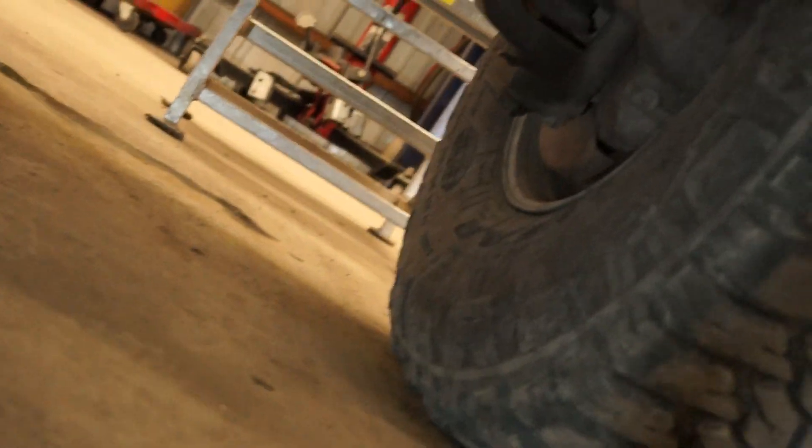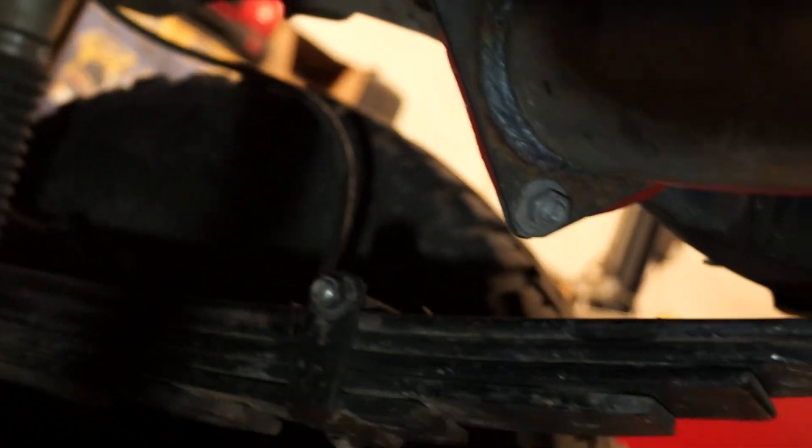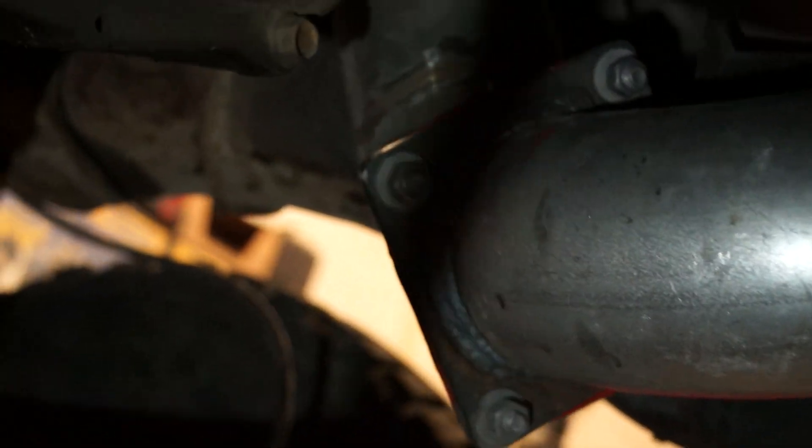The exhaust is a four-inch downpipe to a five-inch for the rest of it. The downpipe's four-inch because I can't fit a five-inch pipe around the shackle hangers. So that's a four-inch section right there — it's a flange. I could have done it with V-bands but V-bands cost money and this didn't. I just cut a couple flanges and bolted them together.